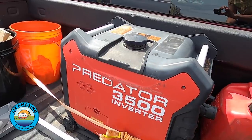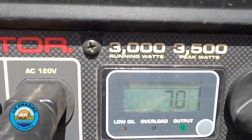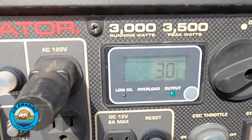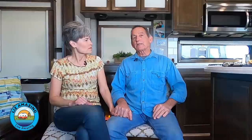We have a portable generator with a display showing how much current is flowing. I did a test pre-installation of the Soft Start. With the converter and refrigerator running, when one AC kicked on, the spike hit about 45 amps — which would have blown a 30 amp breaker. Then we did the same test after the Soft Start installation, and the highest I saw was 17, maybe 18 amps at one point, just for a microsecond. So it cut the inrush current by more than half.